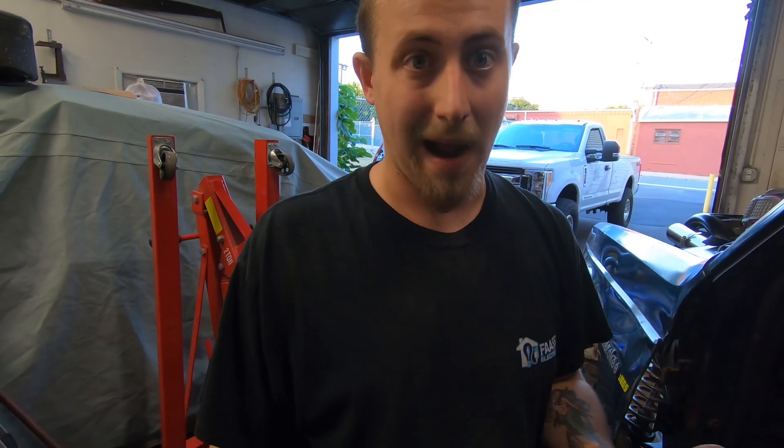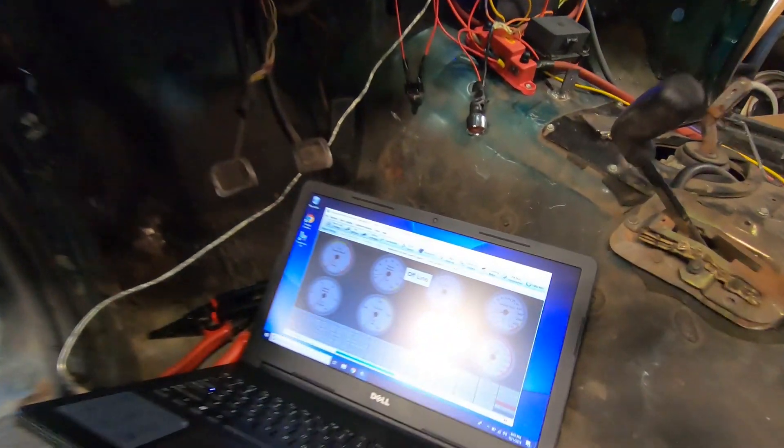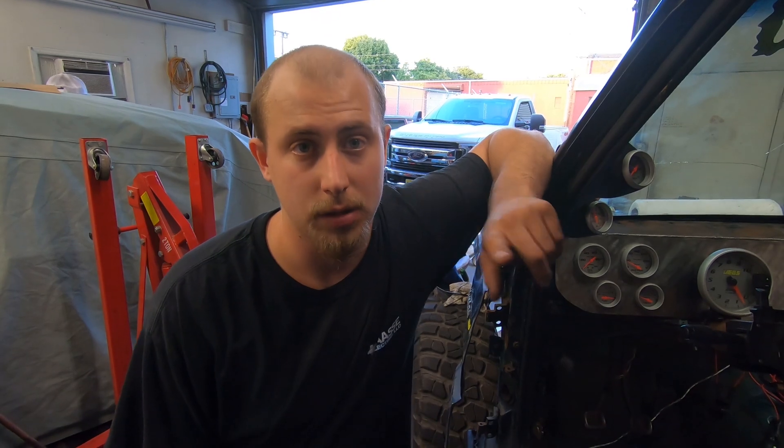So I plugged it in and it seems like some stuff is off. It looks like I'm missing ground for a lot of the sensors — for some reason they're not grounded. I figured out I had a spare ground and wasn't getting a throttle position sensor ground. I hooked it up to the spare ground and all of a sudden my throttle position sensor worked fine. Now I'm afraid that everything in the relay board isn't properly grounded, so I have to check that out and figure out what's going on.